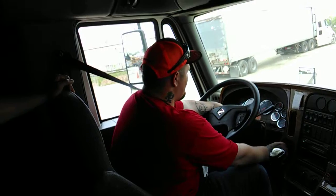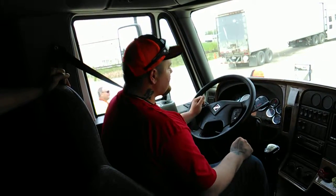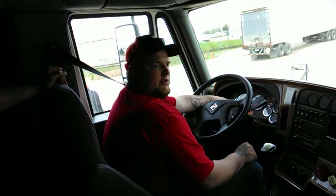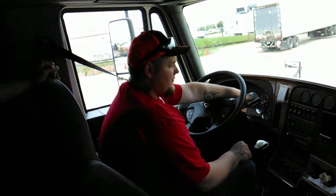I'll keep my hand on the key. My oil pressure has begun to rise. When I put my lights on, all my dash lights are working properly. My water gauge has risen to the proper levels. My voltmeter is at the proper levels of 12 to 15 volts.